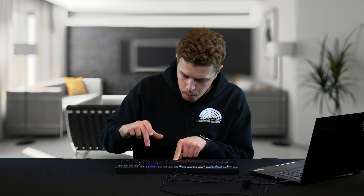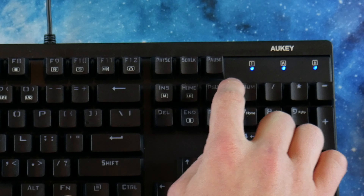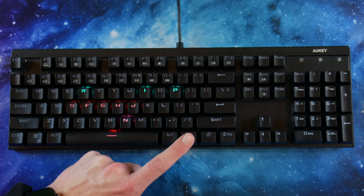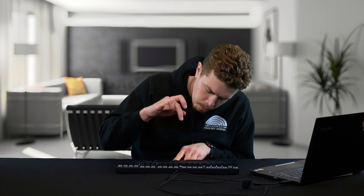If you select LR1 and then FN and the Home key, the 1A and down LED lights in the top right-hand corner start flashing. This means you can go and select whatever keys you'd like to light up for your custom mode. Once you've selected all the keys, you can select FN plus S or N to save your custom lighting mode, which you can retrieve by going back to LR1.